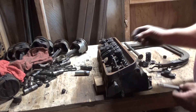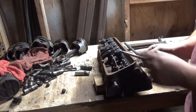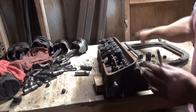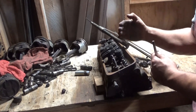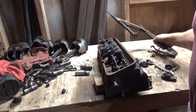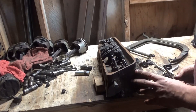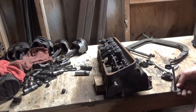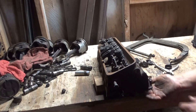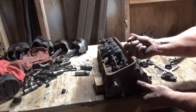I'm not going to lie to you — the reason why this stuff was already out, like the o-ring, the o-ring goes right there. I already did this demonstration but I had this tool adjusted way too tight and I was squishing the spring so far — it's kind of dumb, but I had this adjusted bad, so I had to redo this. To put this back in again: you always want to put new seals in everything. This is just for demonstration purposes only, so don't call me out for not putting the new seals on. You always want to put new seals anytime you take your heads apart — usually they're bad anyway, these are crispy.